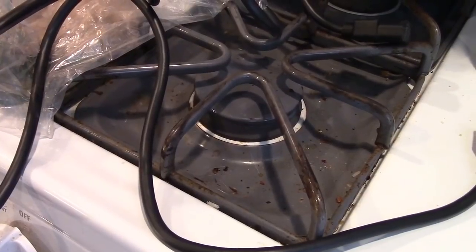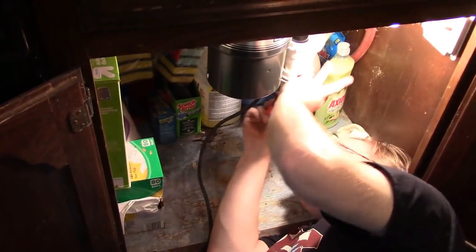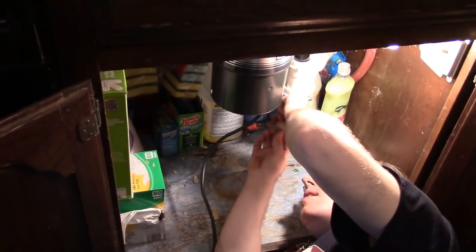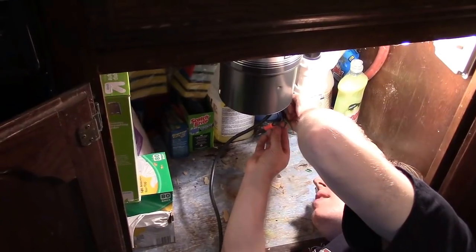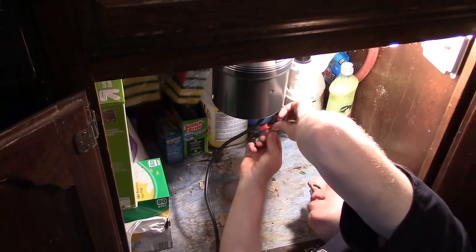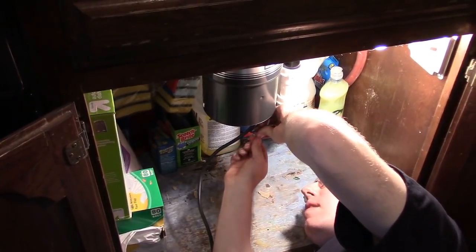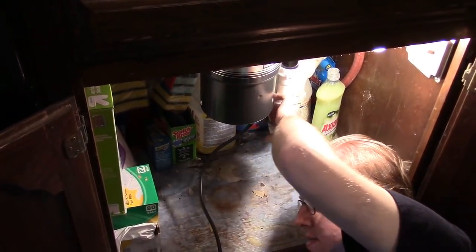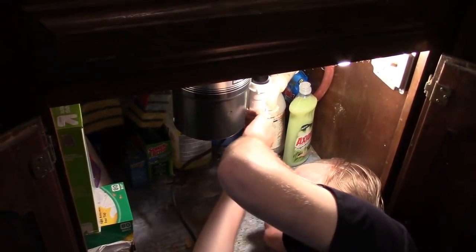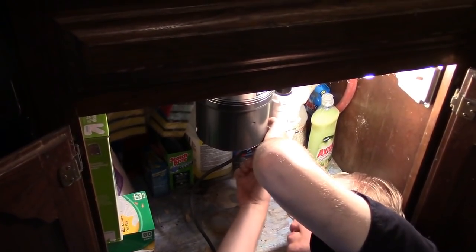So I'm going to wire this up now. So there we are, wiring in. The computer power cord has a brown, a blue, and a ground. The brown is the hot, the blue is the neutral, just for future reference. So that's that, and we're going to put that all in and put the cover plate, and then I'll run the wire and we'll give it a test.